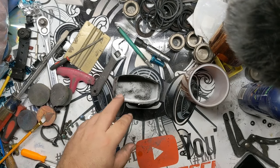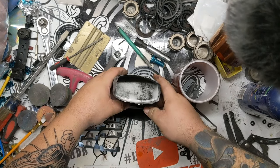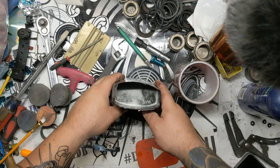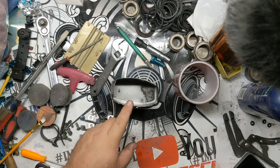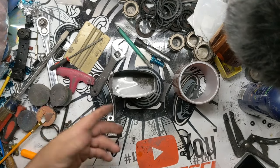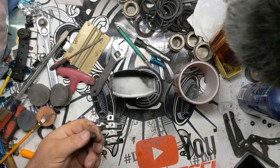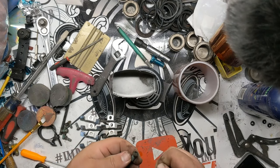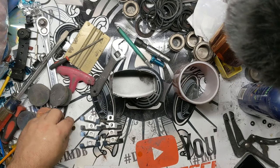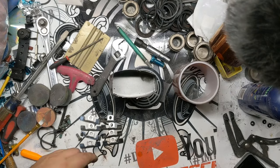This is an acid, so be careful. You don't want to keep your hands in it. You might be able to see on camera already, this is actually bubbling. That's the cleaner actually working. So yeah, we'll come back to those, and I won't show them again. You're just going to see them during the assembly, but you'll see that everything comes clean. The bolts don't ever really come clean. These are a kind of dingy gray, even when brand new, so they don't ever look great, but it gets all the extra crap out of the head of them, so you can get your tool back in with no issue.